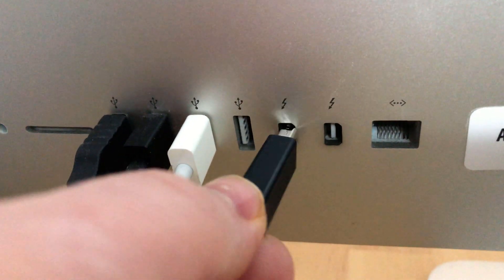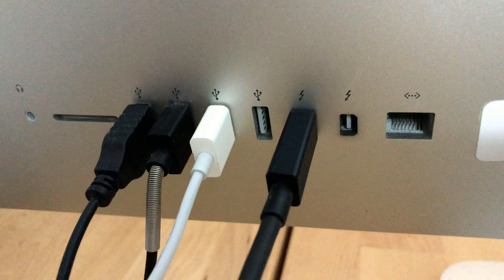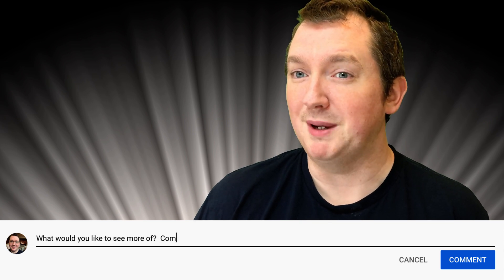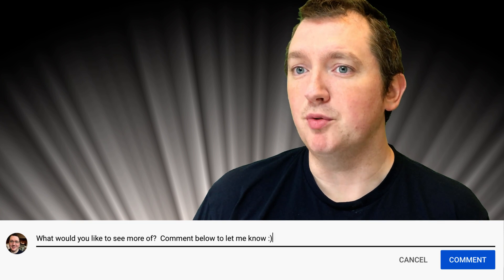Once everything's reassembled, we just need to plug it in and turn it on. I booted up my iMac in recovery mode to reinstall my operating system. I was hoping to be able to RAID the two hard drives in this enclosure, but it looks like Apple has disabled that for some reason on external devices, which is a shame because I could have got a bit more speed. Once that was all set up, I set my external drive to be my boot drive. As part of the installation process, I ended up migrating my internal drive to my external drive, and once everything had copied across, I formatted my internal drive — to make sure I didn't accidentally boot off the wrong drive and save files in the wrong place.